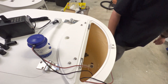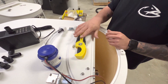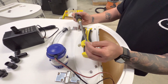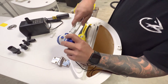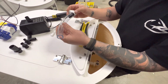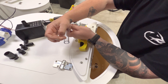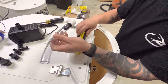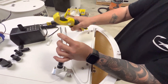The two tools you'll need are a pair of tubing cutters — that's what we use here — and a big flathead screwdriver. The screwdriver isn't necessary but it helps for getting that fitting back onto the Danco once we put the new pump in. First thing I do is pull your pipe off the pump and set the pump out of the way. A lot of times this pipe will fit as-is, but sometimes you have to trim anywhere from a half inch to an inch off the pipe because the new pump is a little bit bigger. I'm going to go ahead and trim about an inch to start with.